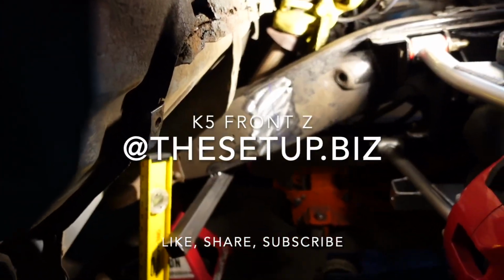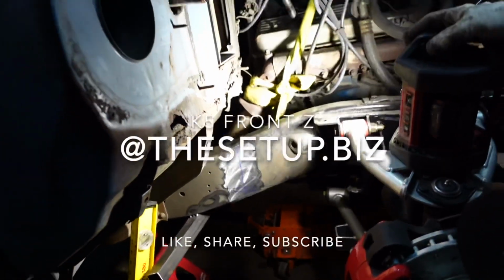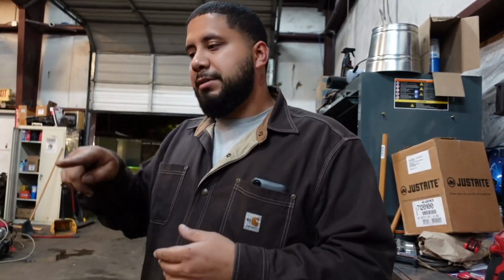This one's a little bit different than a C10. The frame actually hangs an inch lower in the back than it does in the front. So with that being said, we're going to cut the frame in the back to section it 1 inch, and then we're going to do that to the front. Except in the front, we're going to do a 1.5, so that way the control arms aren't dragging on the floor. Let's say he's ever riding low or he hits a bump or anything, it'll be a 1/2 inch higher than the rest of the frame.